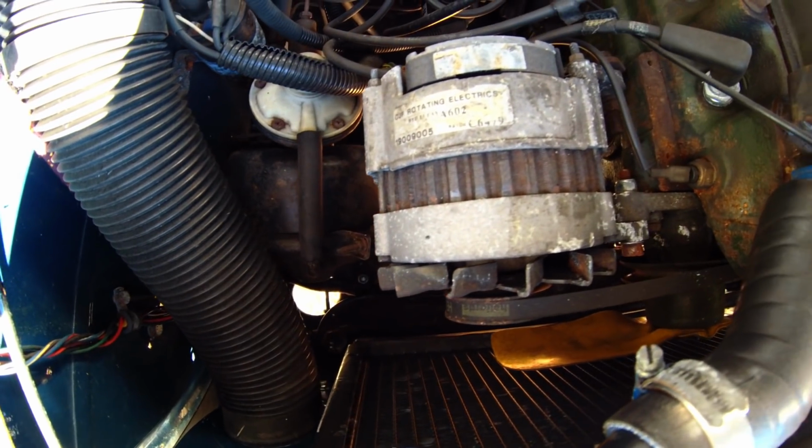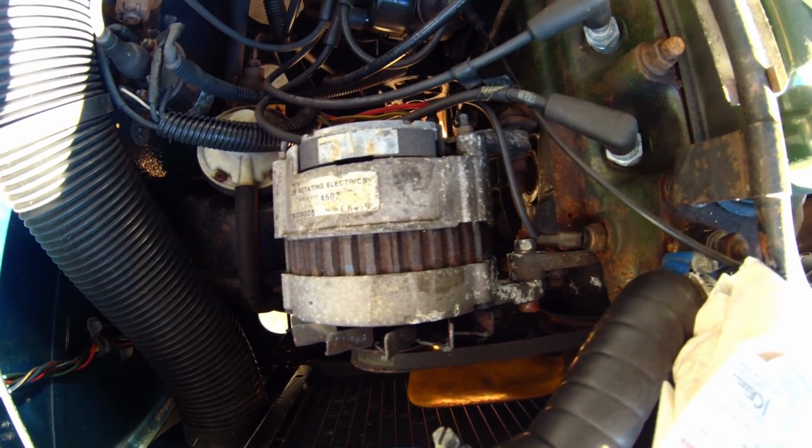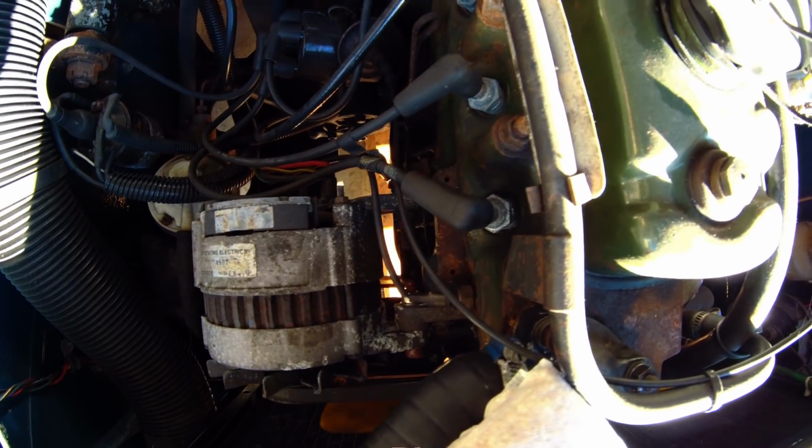In a Morris Minor, that's ridiculous, I don't need all of that. But that gearbox might fit in place of the Type 9. It's definitely bigger, but it looks like most of the biggerness will actually sit in the engine bay. It's definitely heavier, and that is a challenge because it looks like we're going to be trying to support that weight using a combination of the support where the standard gearbox mount is and then a support that probably rests somewhere on the chassis legs up the front.